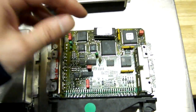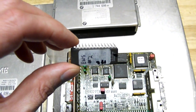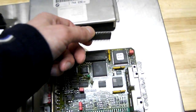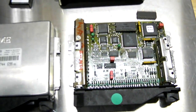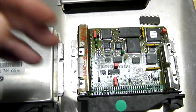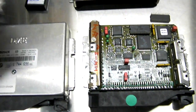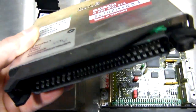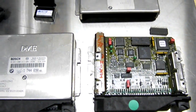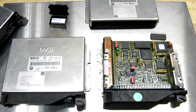Today, as a test, I'm going to remove the stock computer chip from this ECU — the one that was in the car — which has EWS coding for the immobilizer. I'll pull it out and throw in a non-EWS performance chip. I'll also test out a maroon-label 413 ECU which has no EWS coding, found in pre-95 E36s and E34s. We'll take it step by step and locate the wire which can be cut or disconnected from the pin.